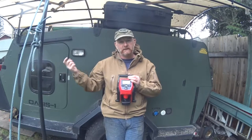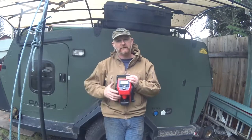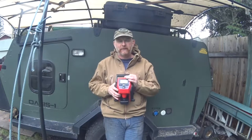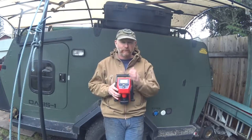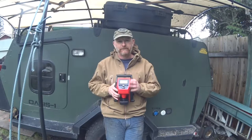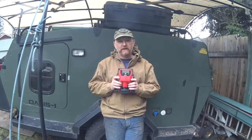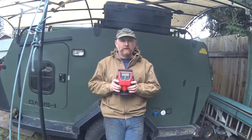The 12-volt system on the truck — the cigar lighters are rated at 10-amp breakers. When we were in Oregon they kept blowing the trips, which meant we had to keep resetting them and it took a long time. Now I can give Sandra this inflator and she can go fill up the tires on the trailer whilst I'm doing the truck. Let's see how this works.